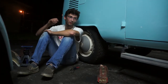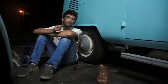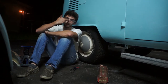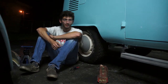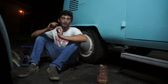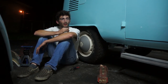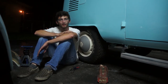It was actually a pretty simple fix — it was just the e-brake. The spring had popped off of its little channel and fallen on top of the spring for the brake shoes. Whenever I would hit the brakes, the spring for the brake shoes would open up and get stuck on the other spring for the handbrake. All I did was pull the spring for the handbrake back on top of its little slot, tighten it up at the handbrake itself, made sure it was tight, and put it back together.